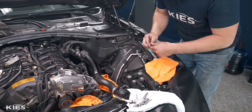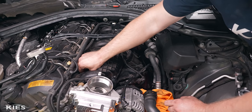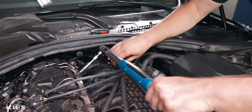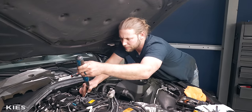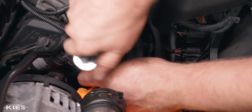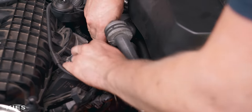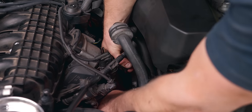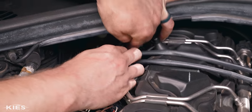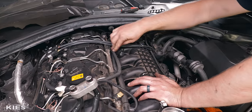Make sure your charge pipe is positioned correctly, then install new intake manifold bolts and nuts — it's always advised to use new nuts and bolts. Torque them all down to 15 newton meters. Slide the charge pipe clamp back on. Plug in your O2 sensors, make sure the little locking piece is snapped in, clip them in and snap them. Then push all the wires back into their little clips and plug in any connectors.